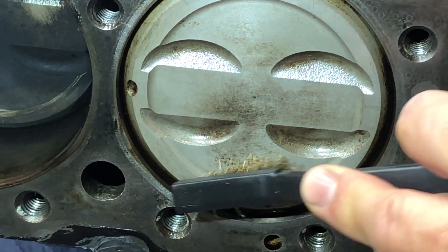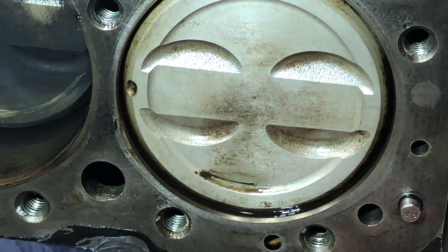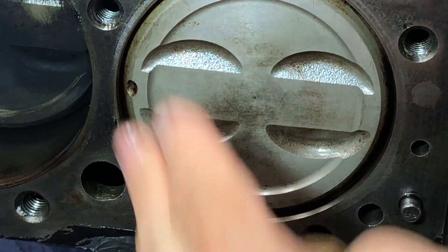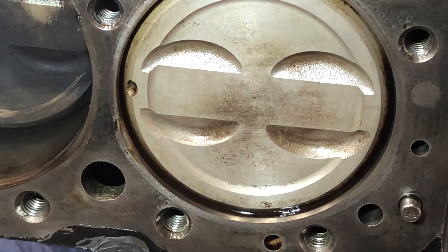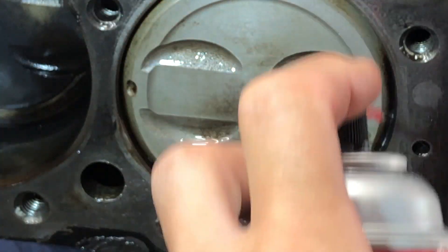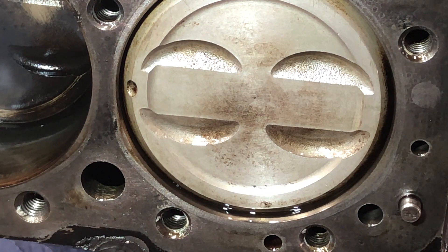Be real careful if you do this. If you get a little brass bristle down between that piston and that cylinder, it's going to be a bad story. So just go around and make sure you don't have any rough spots left. To clean up around the edges, use the brake cleaner. Make sure you go all the way around the perimeter and get in there real good — get all that acetone, transmission fluid, and any debris that may have gone down in there. You can see it's running out clear at the bottom with no little bits of debris coming out.